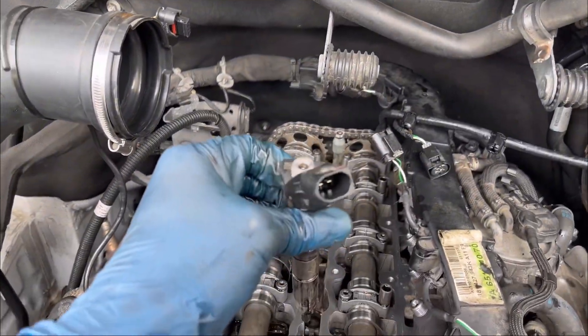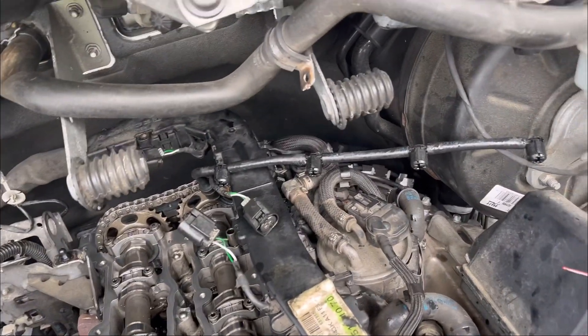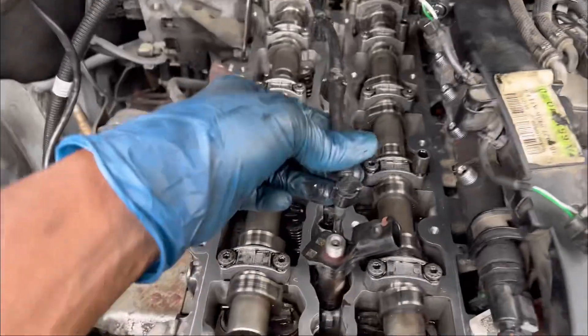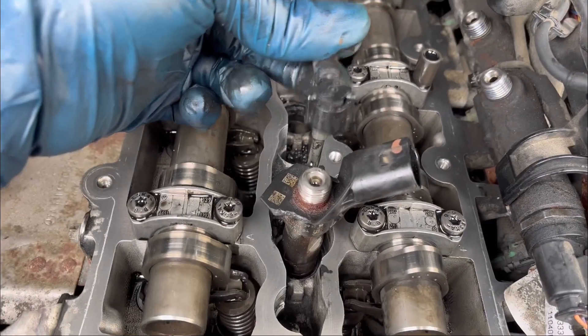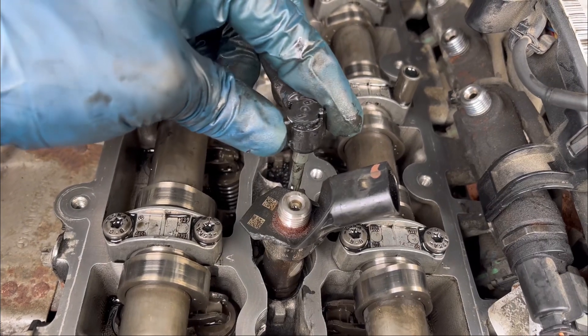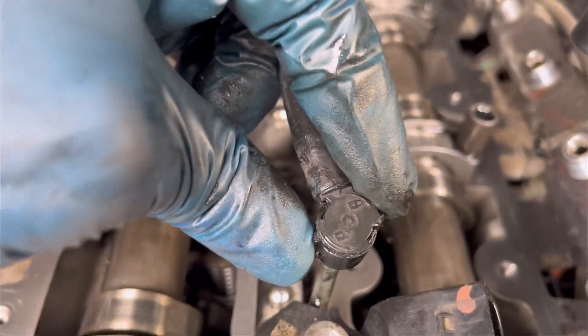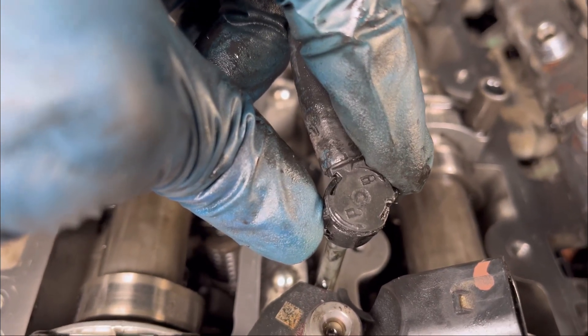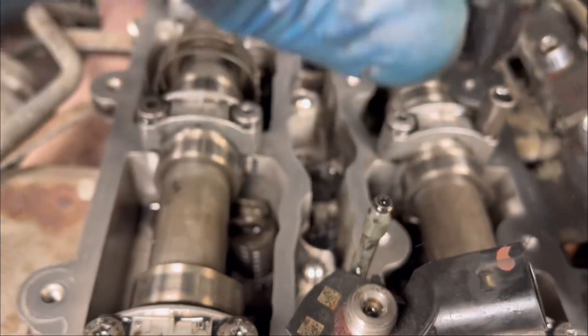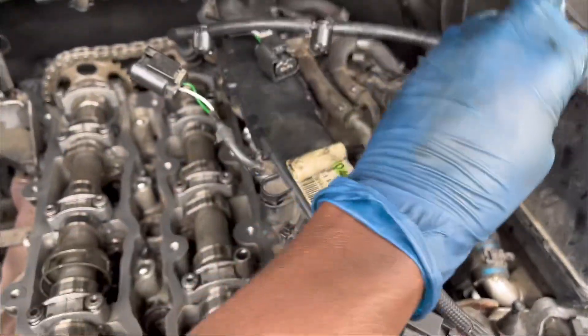This is the fuel injector, and it has a little diesel line that goes on top of the fuel injector — that is how it looks. To undo this one you're going to turn it anti-clockwise. When you look on top you can see the lock and unlock sign on it. Turn this tab here anti-clockwise, then pull it out.